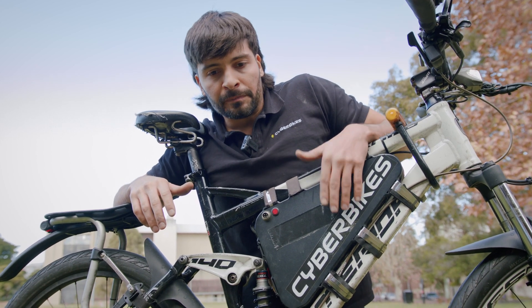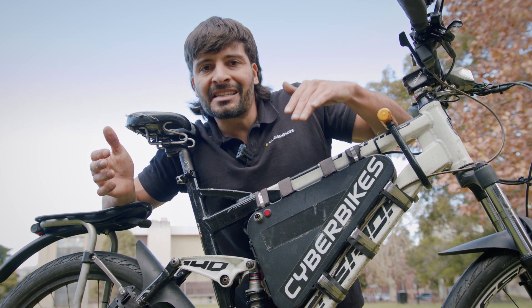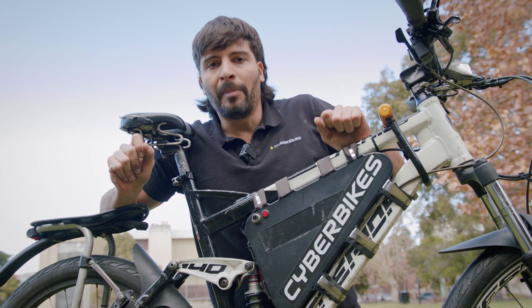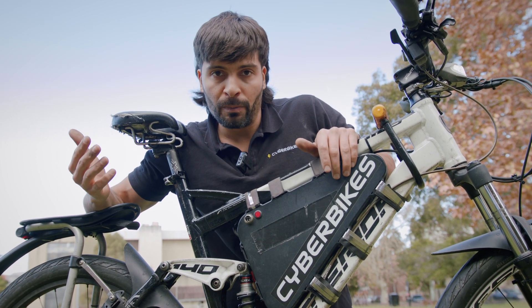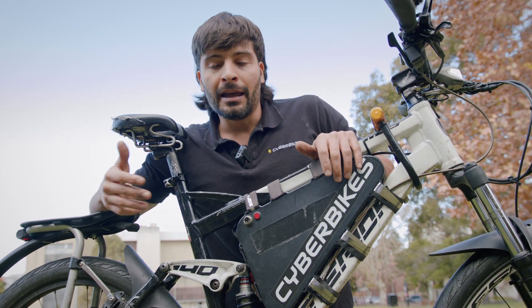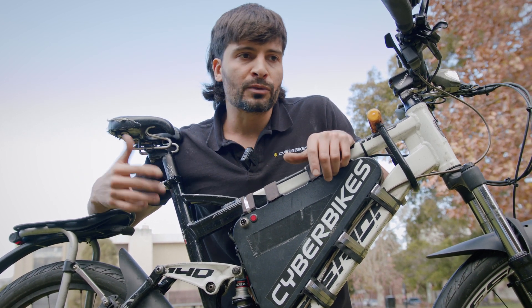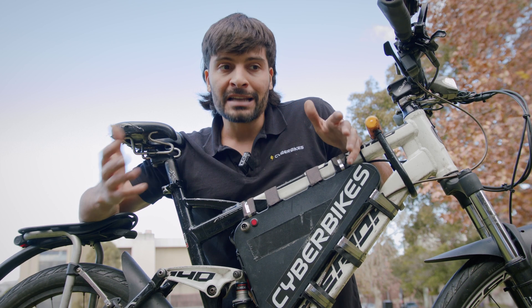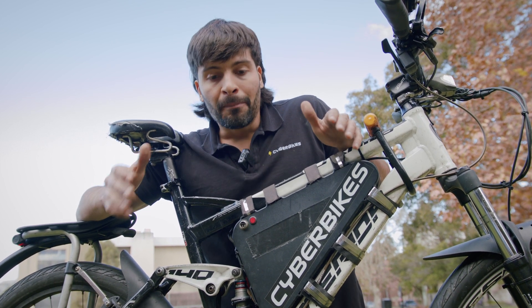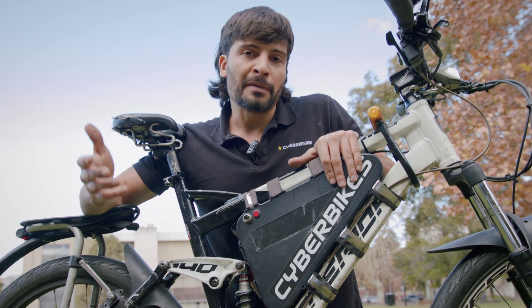Now let's talk about the battery. The bigger the battery is, the lower will be the voltage sag when extracting power — meaning a bigger battery also increases the maximum power of your e-bike. People sometimes only talk about amp hours as range, but amp hours also determine maximum power. Buy enough battery for your motor.